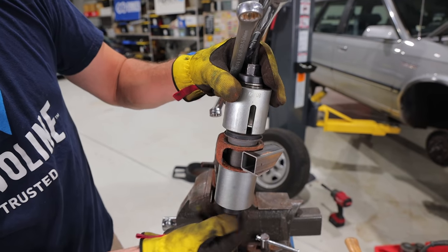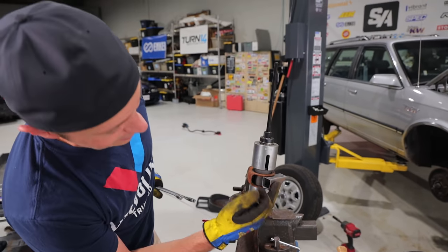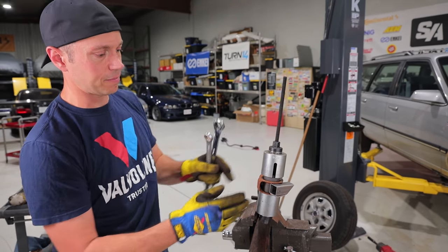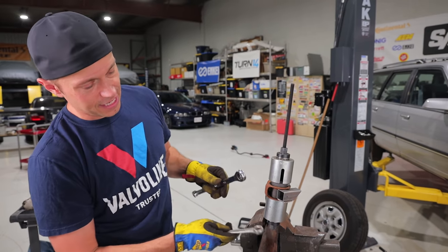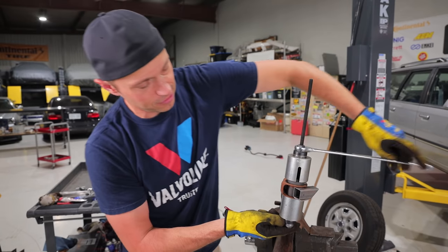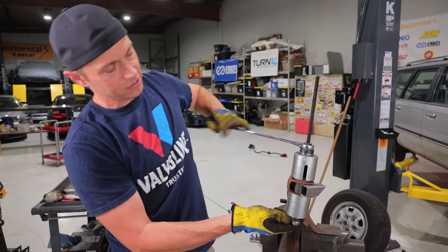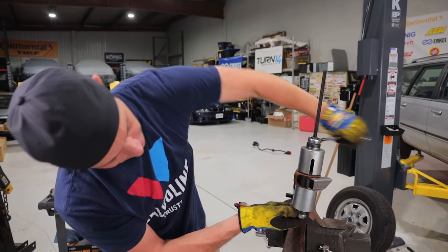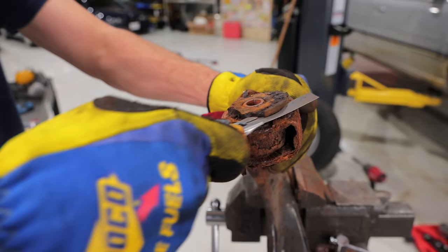Bushing's in place. I've got my bushing installer tool right here. You can see I'm bracing the other side with a piece of metal because this arm does want to collapse — there's nothing really holding it in place. So now with this in place, this will slide in. Like most bushing jobs do require quite a bit of force, but with this one look — it just slides right in because there's so little surface area that you're actually working on. It's quite remarkable how easily this goes in here. Bam — look at that, that looks nice. Looks like it's going to work.